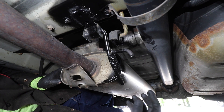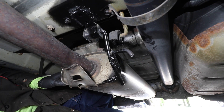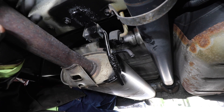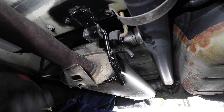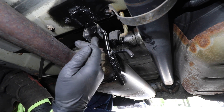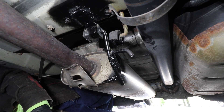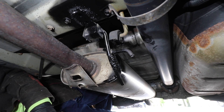I just finished welding on this exhaust hanger bracket. I also added a little bit of high temperature spray paint to help protect the welds. If I take this exhaust pipe and wiggle it around, it moves a little bit as it should — with the new exhaust hanger bracket, there's still a rubber grommet in the holder. Not the prettiest looking welds, but it's definitely going to hold for quite some time.